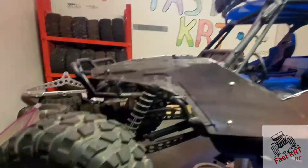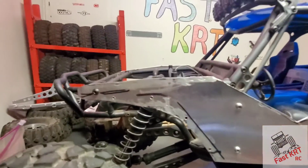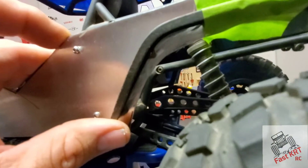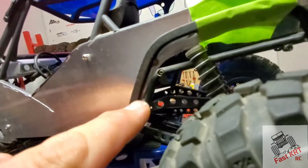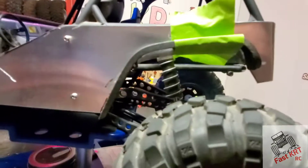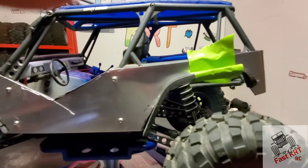I'm taking these fenders — since they're plastic you can kind of bend them to follow the fender shape. I outlined where I wanted them, used a 1/16th drill bit, and drilled from this side while holding it in place with tape. You drill with the 1/16th first to mark it, then go back with 3/32nds — that's the right hole size. It doesn't fit exactly straight but it stretches because it's plastic, and you can even use a heat gun to bend it how you want. It's going to fit pretty nice.